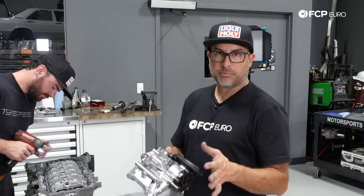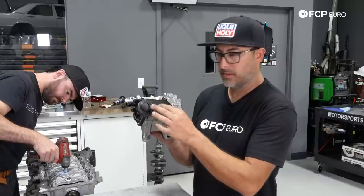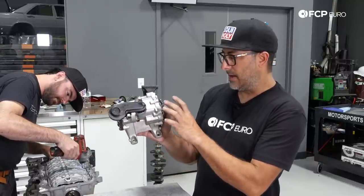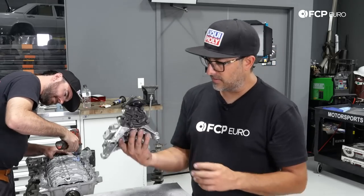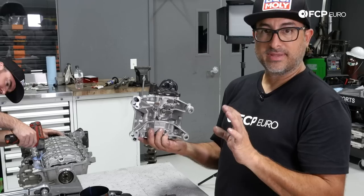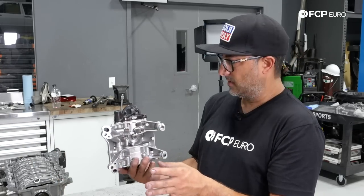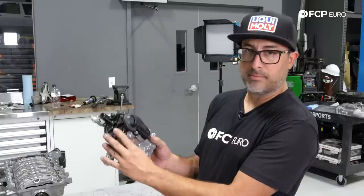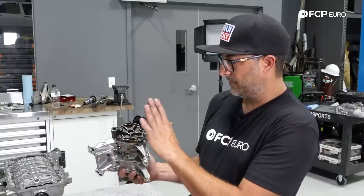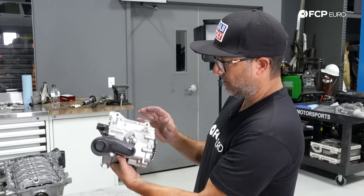The oil pump is back together — we basically disassembled the entire thing. There was a screen inside with quite a bit of larger metal debris which we cleaned out, though a lot of small debris had also gotten into the pump itself through the fairly large holes. We also discovered that the back half of this oil pump is actually a vacuum pump for the brake booster. Since it's a turbo car they built a vacuum pump into the oil pump rather than using a check valve. Because this build doesn't run a brake booster, we disassembled and removed that section, leaving the back half hollow. We filled it with oil and rotated it so it can create oil pressure quickly on startup.